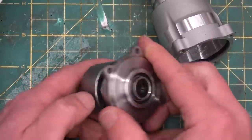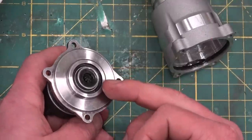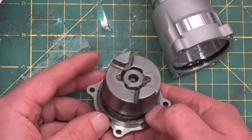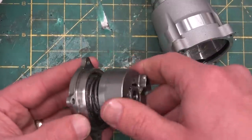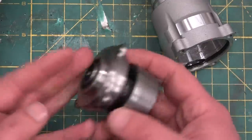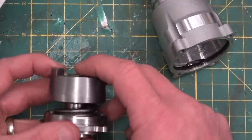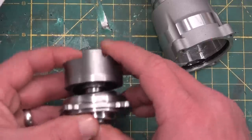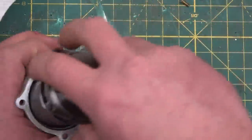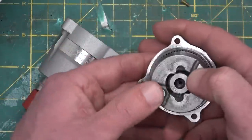no fault of the operator, I was getting worried. But this is a beautiful gearbox, all steel, nicely machined, nice big bearing in the backside, sealed bearing, and then also a seal for the shaft, for keeping the lubricating grease in the planetary gear set, nice big planet gears around a ring that is actually machined into the casement. Nice and clever and compact. Of course, the spring here is what provides the back force for these spinning hammers. They have to get spun up to speed and then hit the dogs on the anvil and come up and over in order to whack it again.